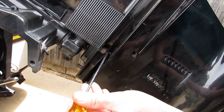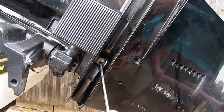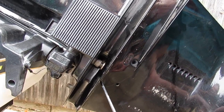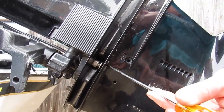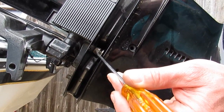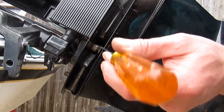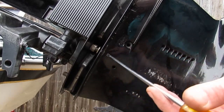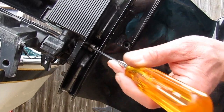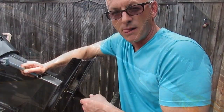On both sides there's a stud sticking up out of the lower unit with a nut on top. You wonder why they'd do that — it's really hard to get off and really hard to get back on. We've been struggling to get the lower unit to separate. What we reasoned out was that if we keep loosening the nut, it pushes up against this piece, which pushes down on the stud. We're going back and forth on either side to get it to come off evenly and we can hear it changing — now we're getting somewhere.